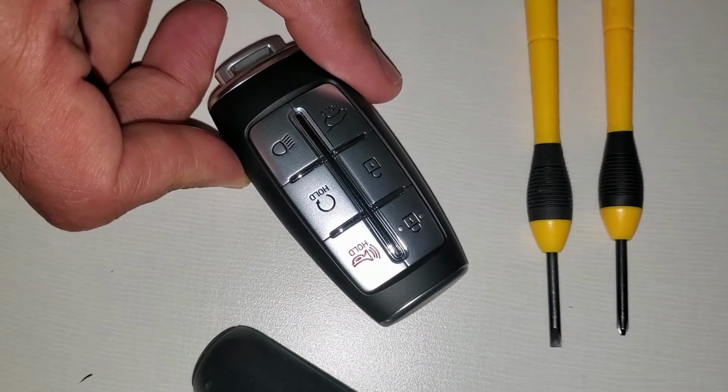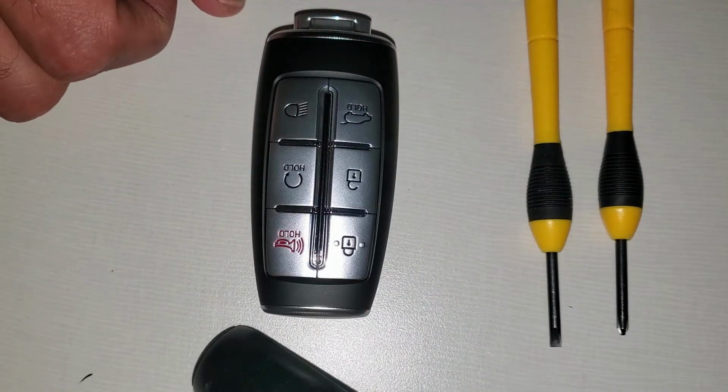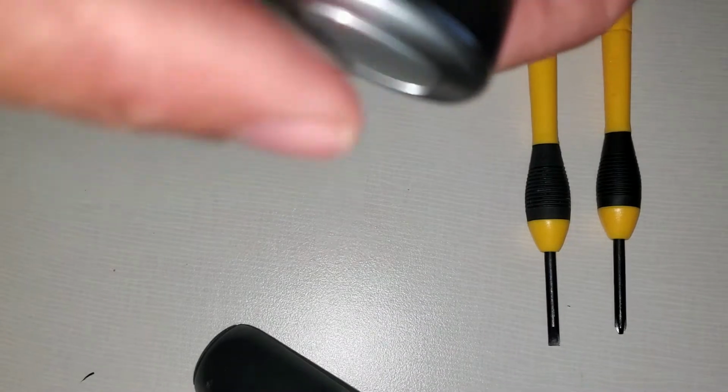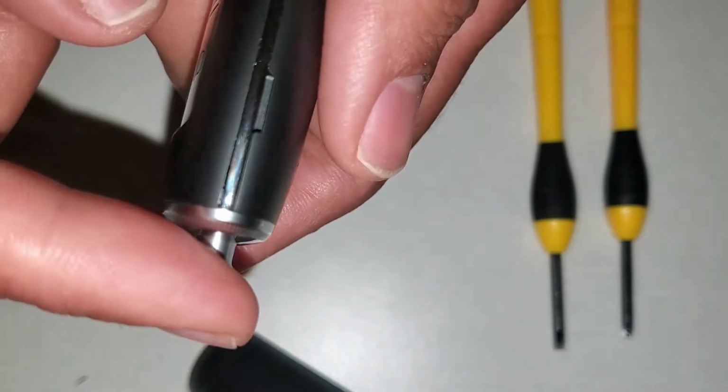We will need two small screwdrivers and a replacement battery, CR2032, and you can click on the link below to get it online. So first, what we have to do is take this part out. We do that by pressing this button right here.